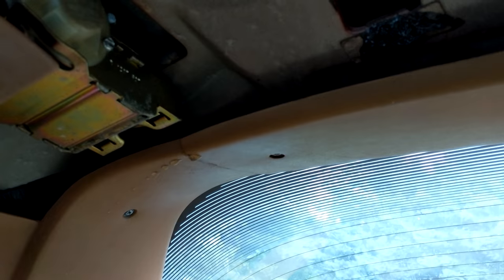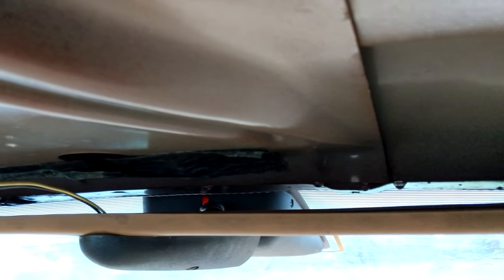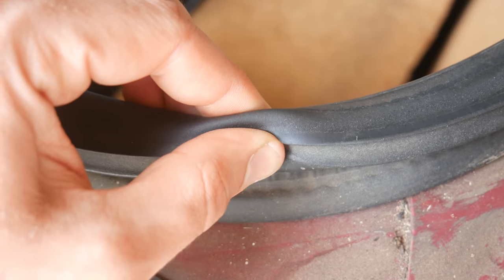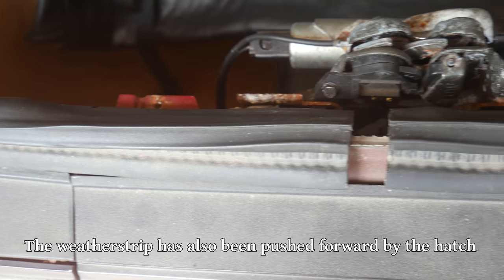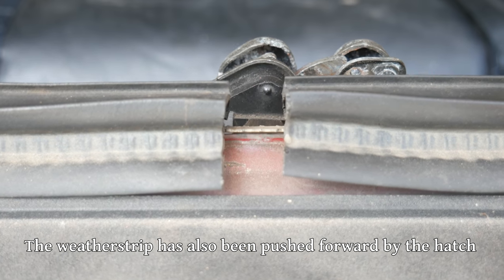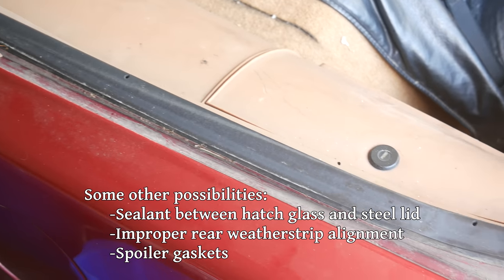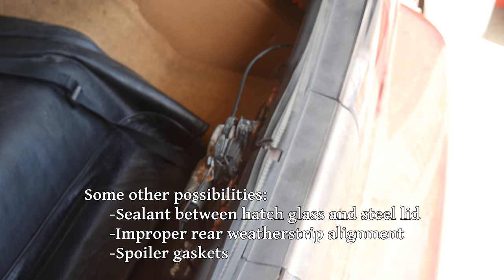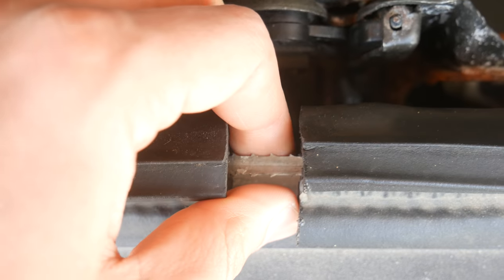But the leak we're concerned with at the moment is at the top of the rear hatch. There was a significant leak somewhere and a lot of water was coming in, pooling on top of a piece of trim and pouring out into the rear seat. The only openings to the outside in that area are related to the hatch itself. First, there's the rear hatch weather stripping — I'm not sure if it's been replaced, but it looks like it has. The material is in good condition, although there's quite a gap at the rear right above the pull-down mechanism, which would explain some of the rust and corrosion back there. It's also possible that some roof leakage was dripping down the hatch and getting into the mechanism. We won't be doing any thorough leak testing in this video, but for longevity we'll have to address that in the future.